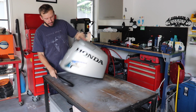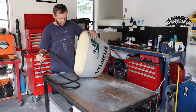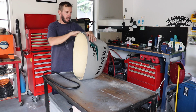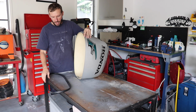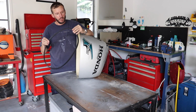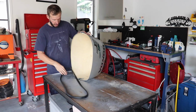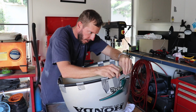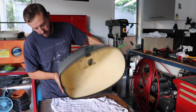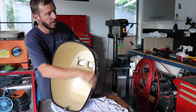Alright, so another thing I'm doing today is changing the seal on the bottom of my motor cowl. Now apparently it just pulls off. Yep. This one's a bit hard and stuffed. So the guys at Runaway Bay Marine just told me to leave this in the sun to get it warm, and then you push it on. So I've done that. Fingers crossed. Yep. Alright, there's the new cowl seal on. I made it look a lot harder than it actually was in the end, but sweet.